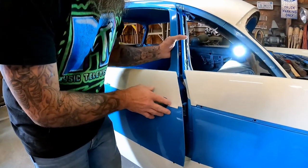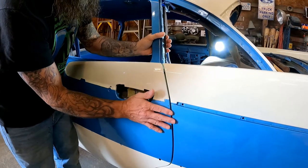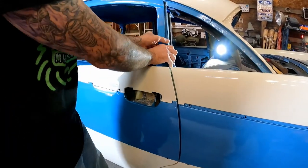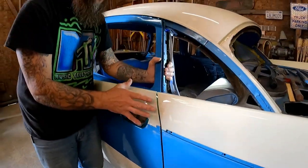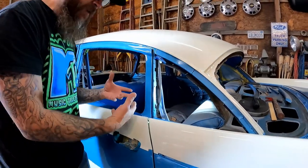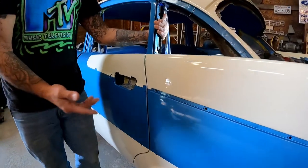Let's go ahead and shut the door rather lightly. It's a little too far in — I can feel when I rub my hand across here I can feel the edge of that quarter panel, so I'm going to want to come out with it a little bit. I actually want the door to be kind of loose when we shut it — it'll have a little bit of play. The reason is we've got brand new weather stripping going in, and you want to allow for that. It will take all of that slack out once that's in there.